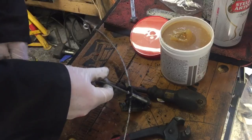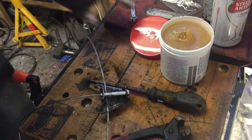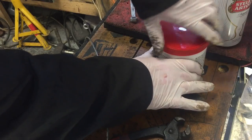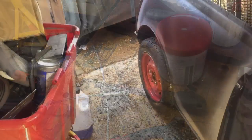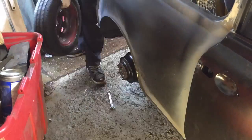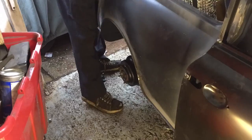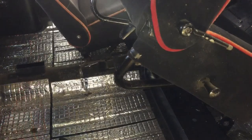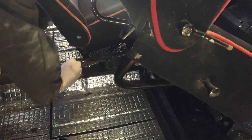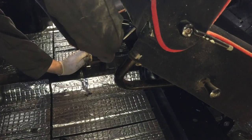Apart from getting the silly clip all the way down and over the other part of the cable, that went on alright. So time to get under the car and try to feed it to the floor — once we take the rear wheels off, because it's just going to be a hell of a lot easier, and we've got to bleed them eventually once we get the compensator sorted. Okay, I just poked that up through the floor and I'm just going to put this clip back on that holds a little pad, and wind the end of the handbrake cable on.